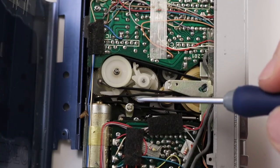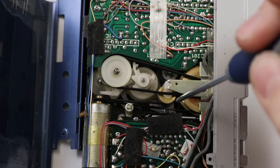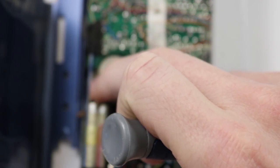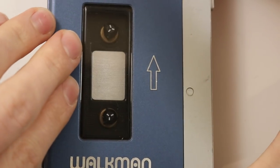Under the battery cover there are two more screws — one in the shadow at the back and one on the right-hand side which holds the battery door down. There's also one underneath which we'll look at in a bit. Then I was able to wiggle off the back piece and that gave exposure to the belts, which you can see are really limp and lifeless. These things are meant to be like elastic bands so they've definitely lost their life.